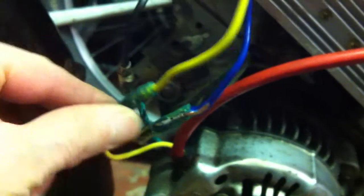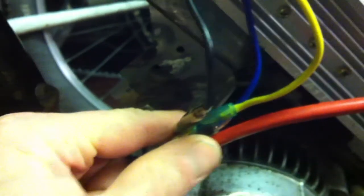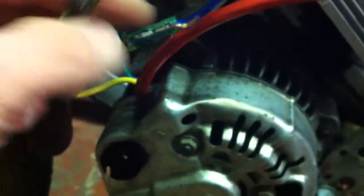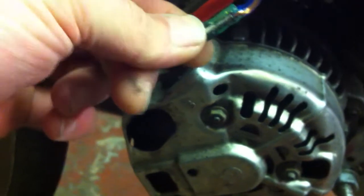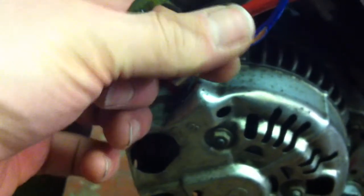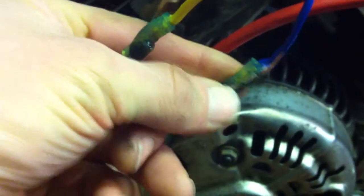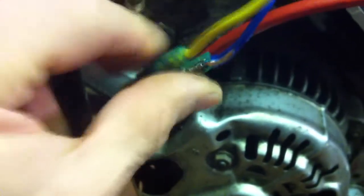Well, here we go. Here's the problem. I had these gathered together, just to keep them out of the way of the pedals. So it seems that with opening the throttle at a high gearing, you'd have been pulling maximum amps, so these would have got a bit hot. And they've melted together and shorted.